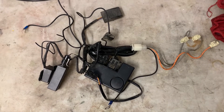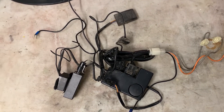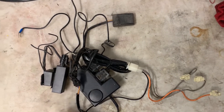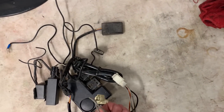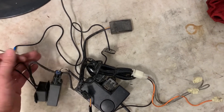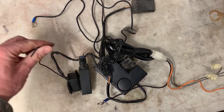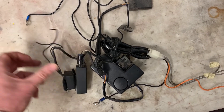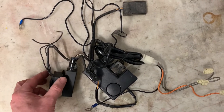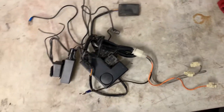This is the Scorpio alarm system and I just removed it from the Rossi R1. It's fairly straightforward to remove. There's just a couple of connectors from the battery and these T-taps were on some of the signal lights and the tail light. These two wires here were tapped into the ignition wire — so this is the ignition disable module. Now that has been removed. It certainly was not functioning properly.